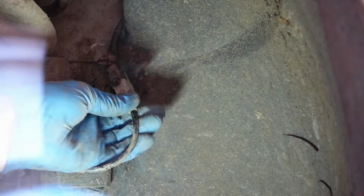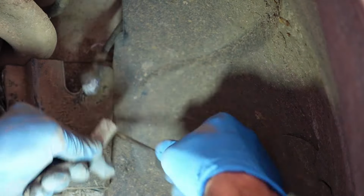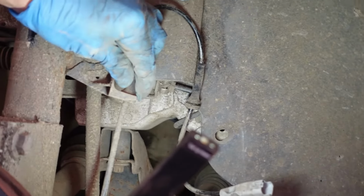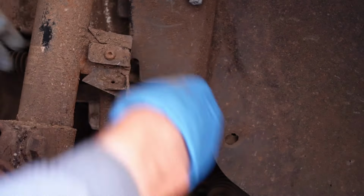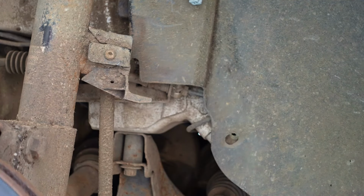So we'll do that now. We'll lift that tab up with a flat blade screwdriver. You can just gently pull them apart, and that's that part done. And then we'll get it off this tab down here. So removal of that tab there, it literally just flicks out of that, nicely does it. And now we're left to pull the part out the back of the hub.